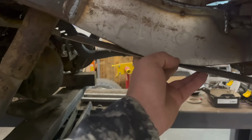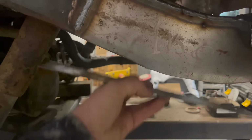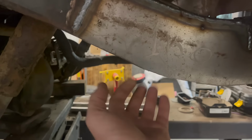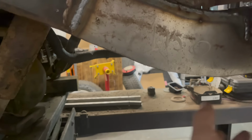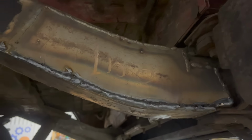Oh, goodies. Right, so I've got this side done, both sides, and then what we'll do is wrap that round and weld it and wrap it round as we go, and then we can dress the edges off. Cut this a bit proud, flap it down, and then we can get that all buzzed up. She's welding on very nicely. Right, so that's all done.